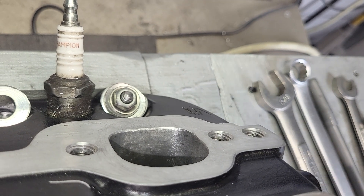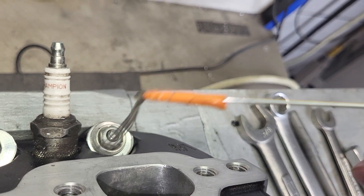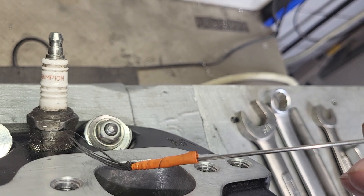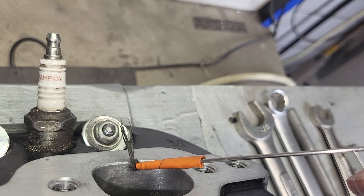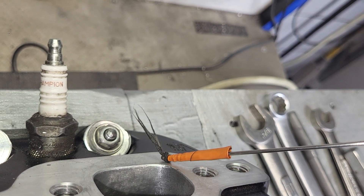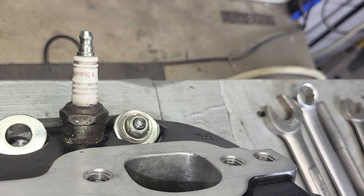Not sure how good you could see that because I was kind of holding the phone and trying to figure this out. The way I have it set up, I have the exhaust blowing towards the bench, so I'm kind of doing everything backwards. But you could tell when I put it right here on the floor, the flag definitely had the most turbulence, which makes sense because that's the slowest air. The rest of it was pretty darn good all the way around. This corner was a little long and a little more turbulent, but everything else on that port is pretty good for the size of the port.